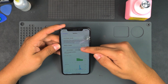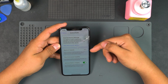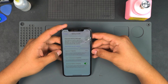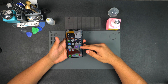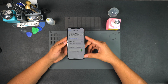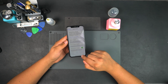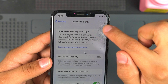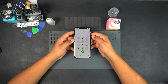If we go into the battery settings, the battery health already says 'Service' and the maximum capacity is at 81%. Usually around 85% max capacity you already start noticing a huge difference in battery life. I also didn't notice on the listing that the screen has burn-in — you can see a gray line at the bottom and a lot of burning at the top. Unfortunately we are going to lose a little bit of money on this.